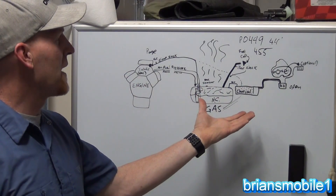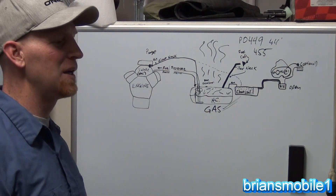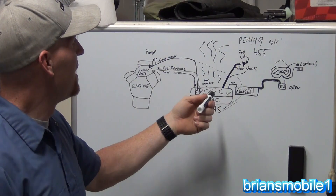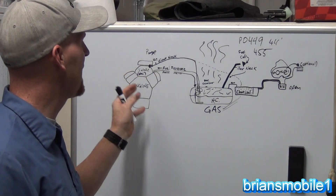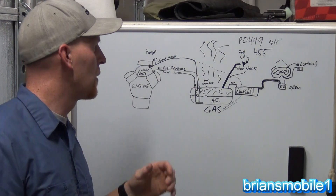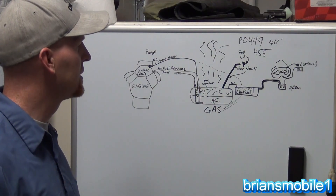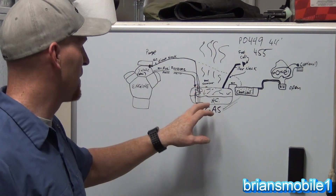So here is how your EVAP system would look if you were to spread it out on a whiteboard. What is an EVAP system? EVAP is just an abbreviation for your evaporative system. Gasoline — hydrocarbons in gasoline form — they evaporate really easily, and that's why we like them. That's why we call it gas: it's so easy to atomize it, which is great for your combustion process. You get away with a lower compression ratio; you don't need a big heavy cast iron engine like diesels do. It's just a simple way to have a whole bunch of energy in a small place and dispense it.